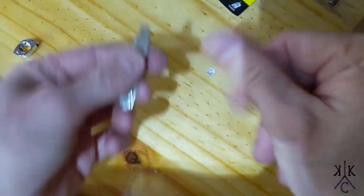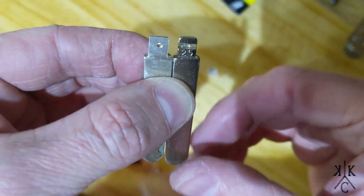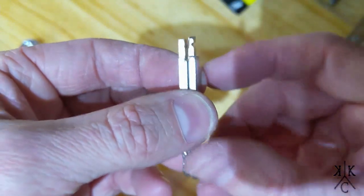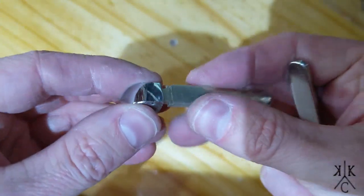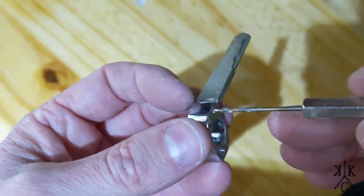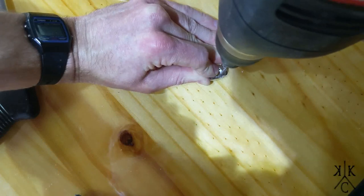As you can see, here's the original key fitting in the assembly. This one wasn't even as good as the first one I did, to be honest, but it still works just fine. You just need to drill where you would put the pin in on this one as well, so that has to line up. Once this is done, all you have to do is put the pin in — I even put some super glue in here, so it's definitely not coming out of this little flip mechanism. It was already pretty tight just from how I filed it and how close the tolerances were.